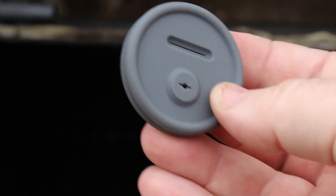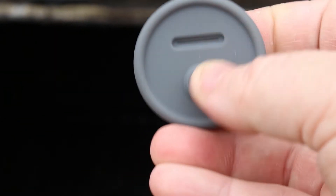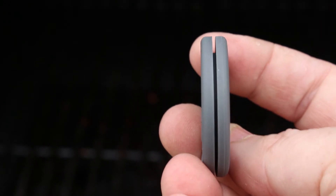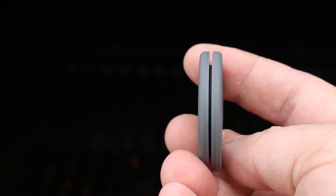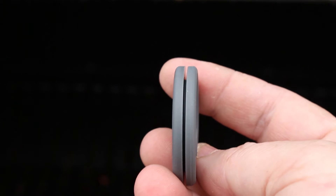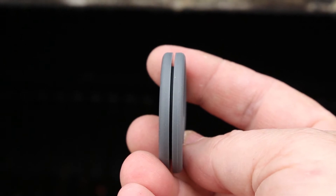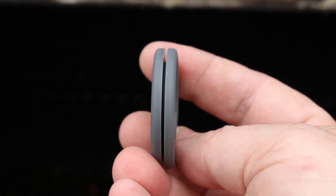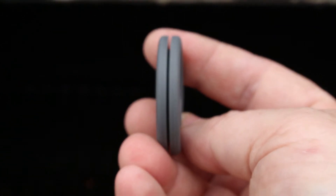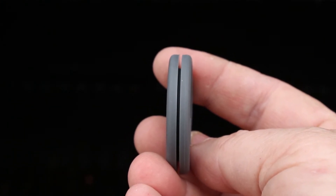I just want to show you this grommet a little bit closer up. Again you can see the two ports — the slit and the hole. If you look at it from the edge you see that channel right there, and you can see the depth of it. That channel is where the metal of the body is going to slide into. It does take a little doing — I had to use needle nose pliers to get some of the more difficult bits to fit, but it did fit. Do make sure that you have that inch and a quarter hole; if you're less than that it will not fit. If you're a little over it probably will fit, but I would suggest going right to the inch and a quarter.